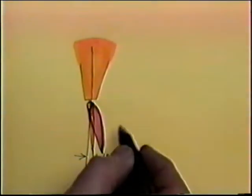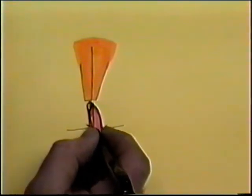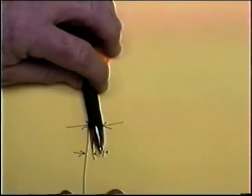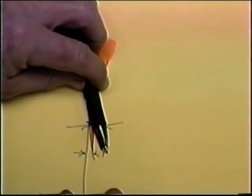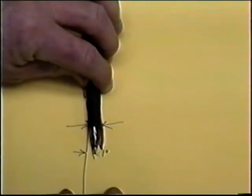And it'll compensate and allow you to run bigger and bigger propellers, which is the whole idea of the four strokes, or the 90 or the 72 or the laser. With this adjustment, when I'm in neutral, I want to have 1 degree of offset, and at maximum throw, somewhere between 1 and 10. And this is an infinitely adjustable thing.